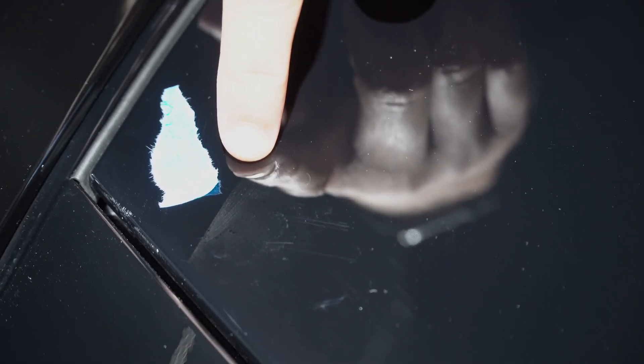On the other side of the hatch towards the passenger side rear quarter panel, we have what looks to be a little bit of clear coat overspray. This could be something that happened from factory because there is a dead-set straight line at the end of it, so this is definitely something that's going to have to be removed. And here on the passenger side door you can see another pretty visible wet sand mark — we are going to paint correct that and remove that one as well.